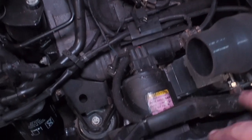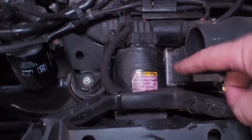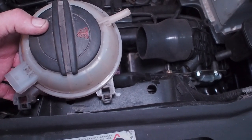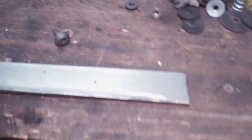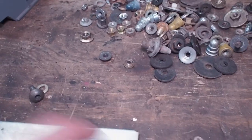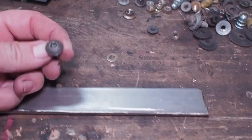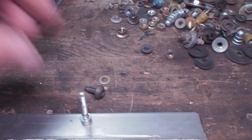The expansion bottle is next and we're going to use these mounts. When I mounted it, the outlet of the bottle sits right on there — it's way too close. So I've got some angle iron for strength to bolt it on and move it away about 30 to 40 mil. I've got some stainless, two mil or two and a half mil, cut so you've still got the strength in it. I'll just draw the holes, measure it up, bolt these straight on, and weld two stainless nuts on there so I can just drop it on.